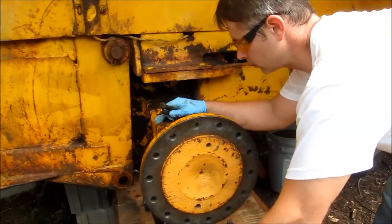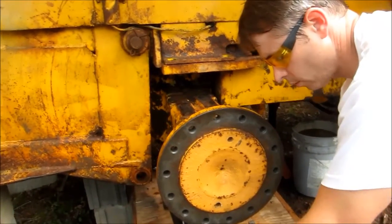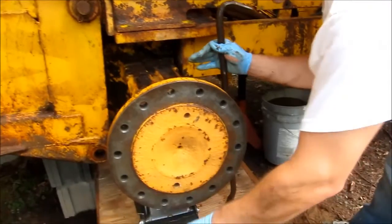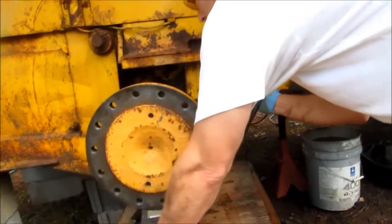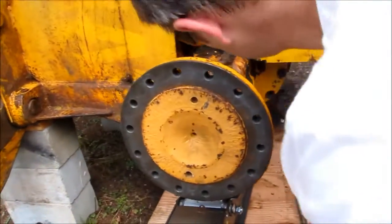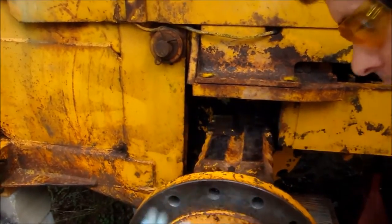The transaxle is lined up — it's close, it's not exact. Since I've got it up in the air, in order to get it lined up, I use a crowbar. Because this thing is so heavy and you might have it on a floor jack, I'll slide the end of the crowbar and use it to bump it over left or right, however which way I need it. Right now I've got it pretty much lined up in the center of where the pinion gear is coming out. It's not high enough yet — still about 4 or 5 inches to go.